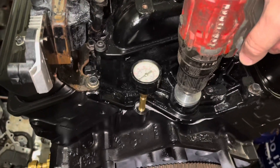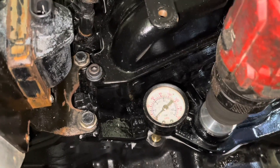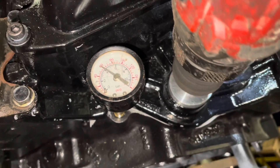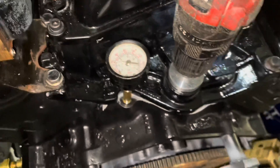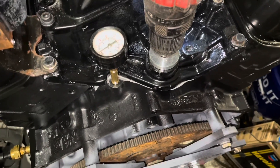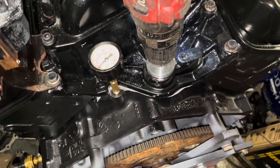Let's try this again — I'm going to turn it over and my assistant is going to start the engine over with the remote start. Made 60 PSI this time; it didn't pump the oil pan out of oil. I'm satisfied that this thing's making good oil pressure — 60 PSI with the engine turning. I'd say this prime is a success.